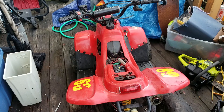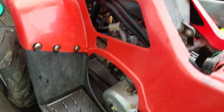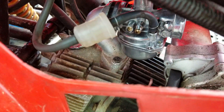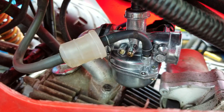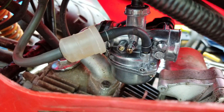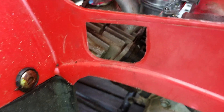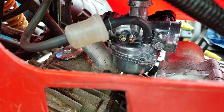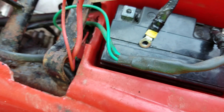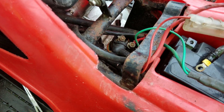He's going to be super psyched. So this is one of those Chinese carburetors right there — see how it's got the round style bowl? I paid $16 for that with the air filter and the fuel filter, and it came with that little piece of hose. I used my clips to cut off the fuel supply to it, and that was pretty much it — this was a bolt-on-and-go. Didn't have any issues with it, thank God for that. I lost one of the little spacer things that go in there, so I have to get a bolt and nut at the hardware store, but other than that it's not too bad at all. So he'll be able to ride this pretty soon.